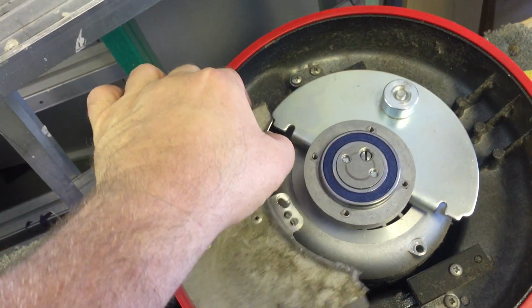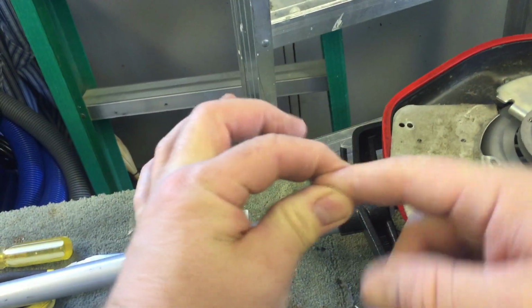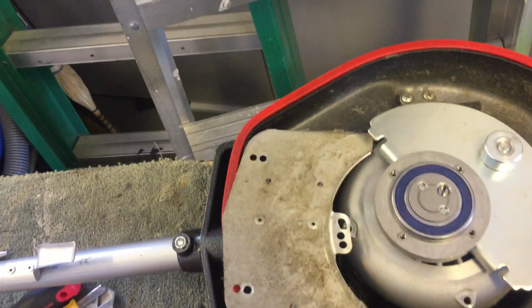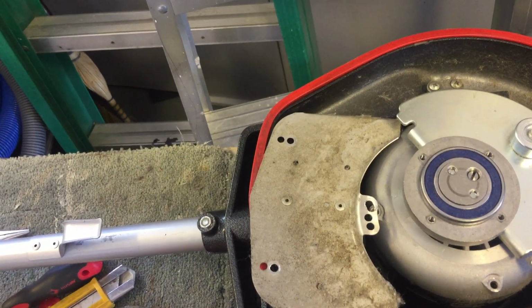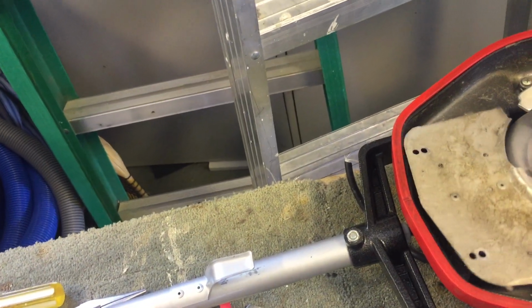I'm just doing this simple repair to the Oreck. That's not a fault of the Oreck. It's just a fact that where you have a wire that's constantly moving, the wires will eventually break. Metal fatigue in that the copper wire will eventually win, and the wires will start to break, and you'll have a bad connection. Things won't work, but these things are always repairable.